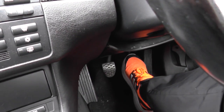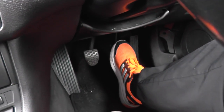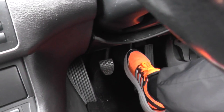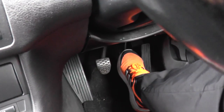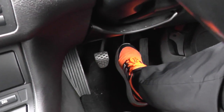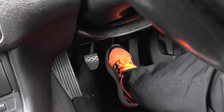The pedal is already rock solid to start with. I'll make sure it's in neutral so it won't stall. We pump the brake pedal until it's really hard, keep your foot on the pedal, start the engine - and the brake pedal should have dropped maybe an inch or two. However, it's staying exactly where it is. That's one test you can do to check if your brake booster is faulty.